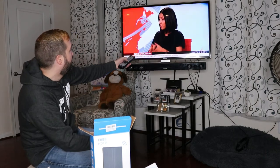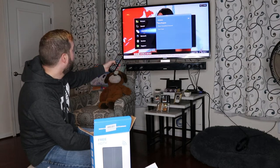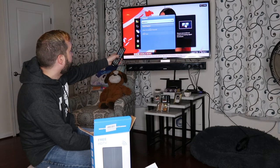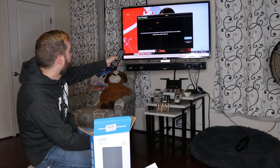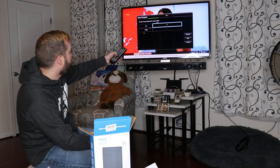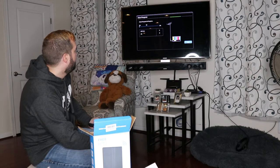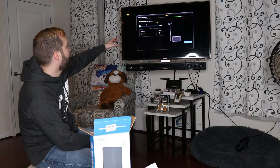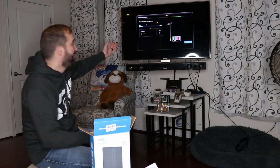When I went to my menu and then under channels, I'm on an antenna right now. I went in and selected auto program, which starts searching for channels. Then because I'm on air — not on cable — I selected next, and then it just sits there and searches for all available channels. This takes time because it goes through every single channel and checks it.